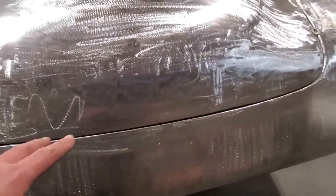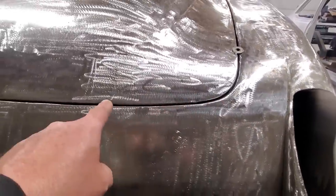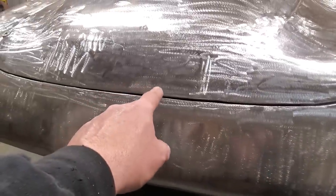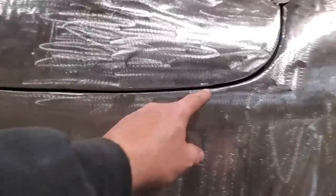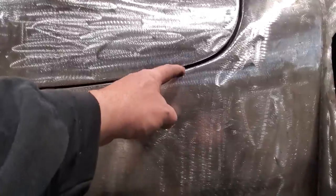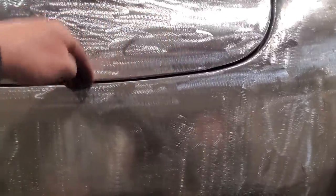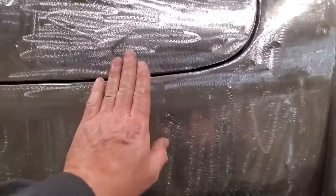I'm going to work on down here now, getting the one here straightened away. And when I get that done, we'll get started on the door. Now in through here, from about right here over to here, that's gone narrow. And over here from about right here to about right here somewhere, it's all gone narrow. I'll do the same process here. I'll cut this here. One of the advantages of this is I made all this up, so this is welded on the inside here. So I've got lots of strength there. So I'll cut this in through here, tap this down. A lot of people will just turn around sometimes and start tapping edges. What ends up happening is the metal has to go somewhere, so it's going to bulge up here, you have a high spot here, then your panels won't line up this way.